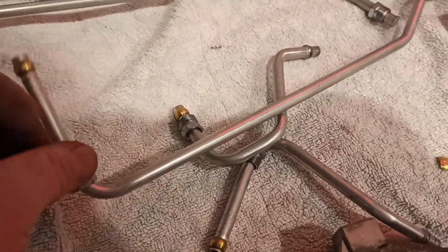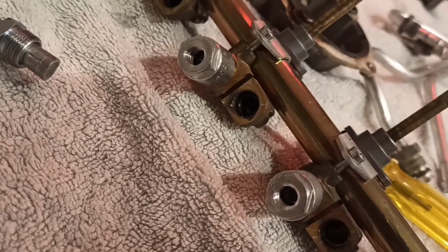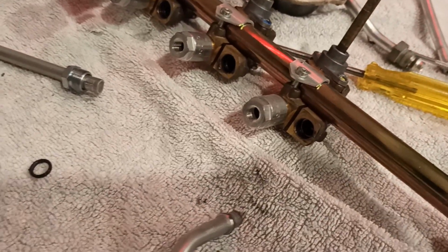And the more expensive machine, well, as we said, we're pretty sure there'll be an O-ring on there because that just sat in the hole. Wait on, let's have a look. Let's get our little pick, and yeah, there we go, there's an O-ring. So that's how it seals up at the valve, at the regulation valve.